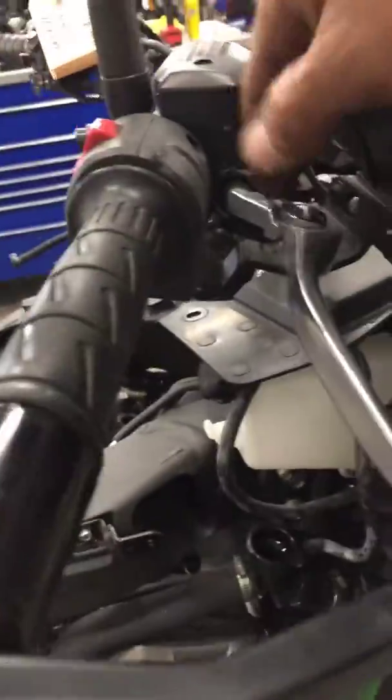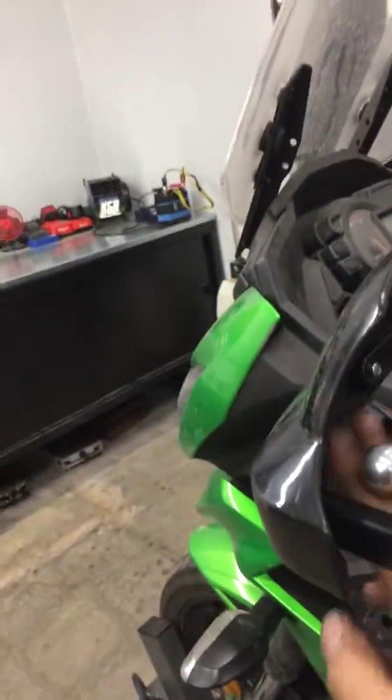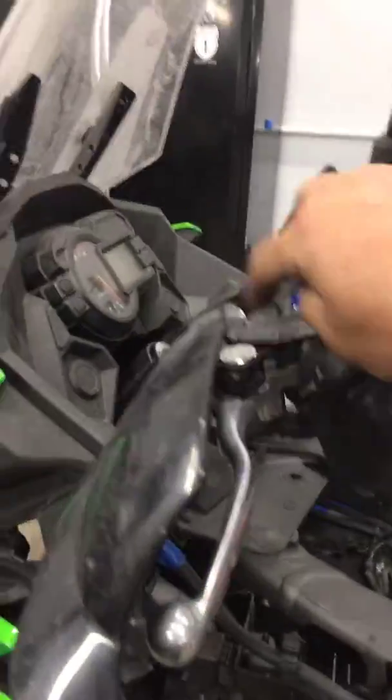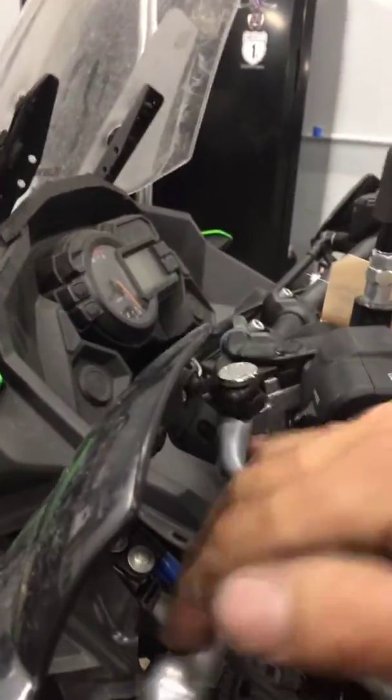Also making sure your overflow is full. Lube all your pivots. I know you had said something about a crash and everything was kind of loose and flopping. So I just kind of bent this back out so it at least was in the normal shape, because it was all bent in and hanging. Tightened that up just so you could ride it for now. I'm gonna pull your pivots on both sides and grease them up, clean the levers so you always get a nice pull there.